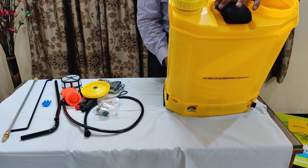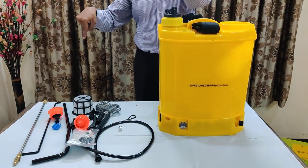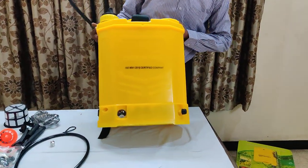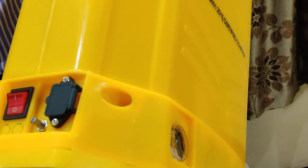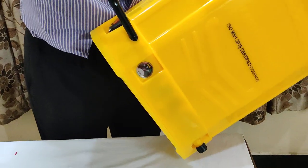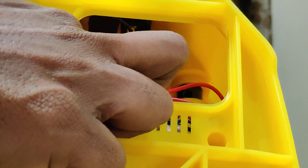To follow the installation, please see the steps carefully and in case if you find any difficulty, rewind the video and see. These are all the products which were there inside this machine. Now I will start the installation procedure. This is the handlebar rod which we have to install first. As you can see there is one hole here on the handlebar rod. I am going to insert this hole inside here like this, and at the reverse of the machine, remove this cap and just carefully hold these wires like this so that this handle can be locked here.